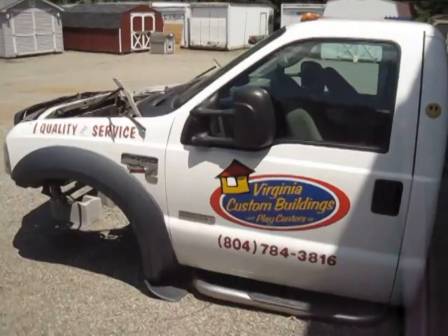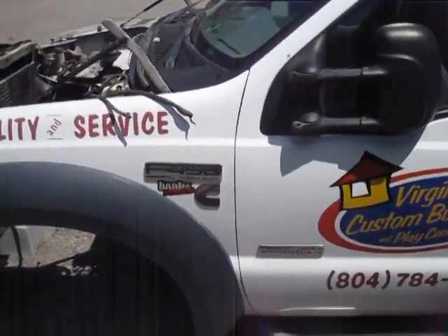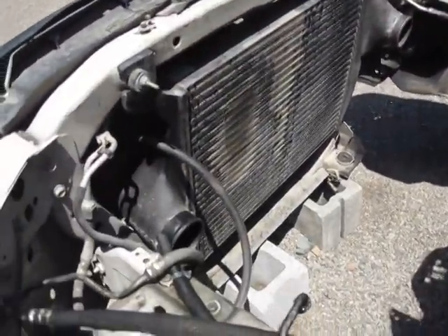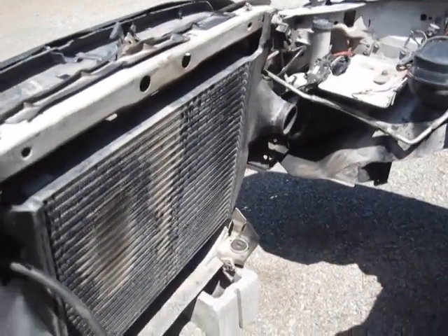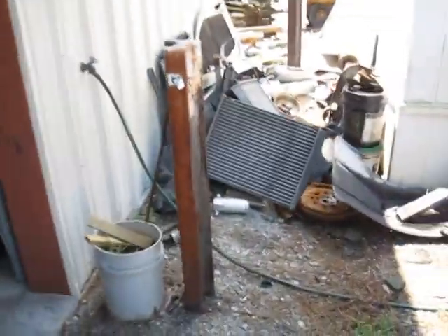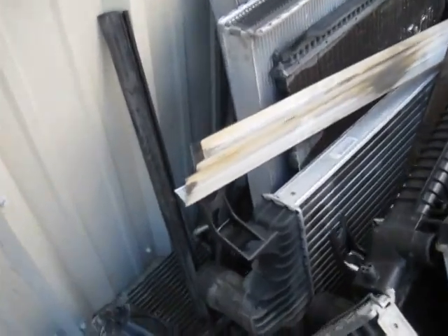Here's the cab off of the truck — it's a 2006 F450. You can see I've already got it badged with the Cummins and the Banks. It's got the big four-inch Banks intercooler in it already, which helped quite a bit. I had to go with that because the factory Ford intercooler would not take the boost pressure that the Cummins was producing.